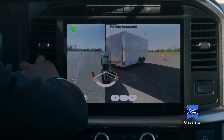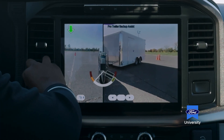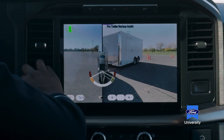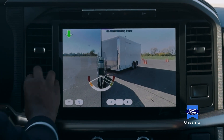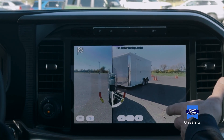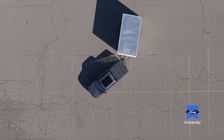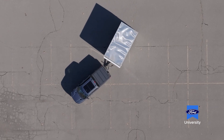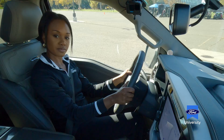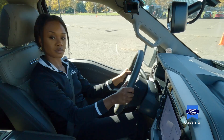You're looking good — follow your instincts here, we're going to experiment with this. So talk to me about what you're seeing. I'm seeing that I'm getting very close to these cones on the right. Let's stop for a second and evaluate our options. Anytime the trailer is not going the direction you want it to, we can always pull forward and bring it back to center. Let's go ahead and press ProTrailer Assist one more time — we've deactivated the system. Now we'll go back to drive and pull straight ahead, keeping going until that trailer is nice and lined up behind you. A little bit more — got plenty of room in front of us. That's perfect. Let's stop right here and we'll go through the same process again.